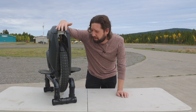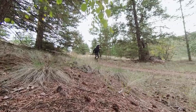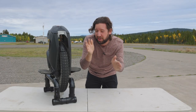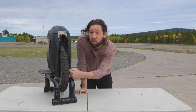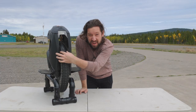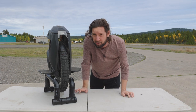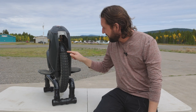If you plan on putting this tire on yourself and you haven't done a tire change before, just note that on the S18 there are shims on the axles. Every S18 I believe has a different shim configuration depending on the tolerances from the factory. So you've got to make note when you take the tire off how many shims are on each side, and you've got to copy that when you put the tire back on — otherwise your tire is not going to fit right in the fender well, you're going to have rubbing issues.